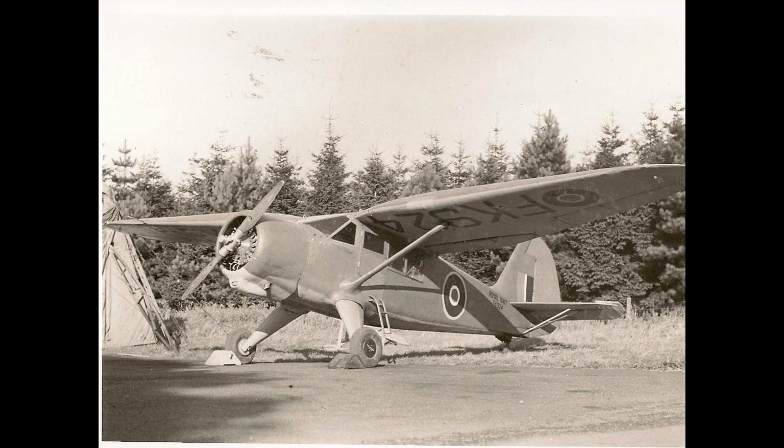It holds 76 gallons of gas, original from the factory. 2 tanks, all gravity fed to the engine. There's no pumps or anything for it. It's got the typical Stinson triangle windshield. Now this is on the original one. The factory one, the pilot window would roll up and down, just out of a 39 Chevy window crank.